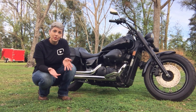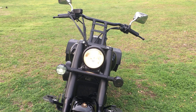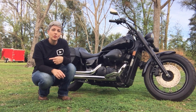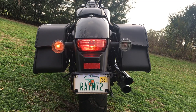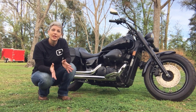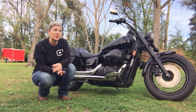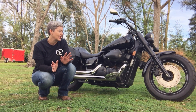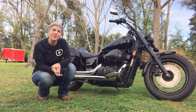So what I ended up doing — because I still wanted the LEDs in the front — I kept the new flasher relay. The final result for now is: smoke lenses with LED bulbs in the front, and on the rear I've changed to clear turn signal lenses with two amber incandescent bulbs in the back. I'm gonna do some research and hopefully find a flasher relay that's correct so I can run all LED bulbs. This project should have been plug-and-play but it has not been. I'm just glad that for now it's all working and I can still get out and ride. Thanks for your patience, thanks for watching, hope everyone's having an awesome day — fly safe everybody!